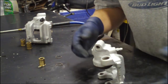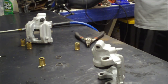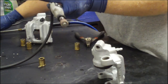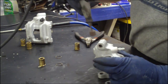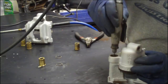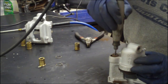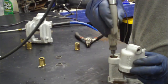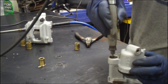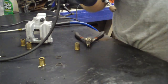You can use a wire brush or a couple of different things. I like to take my Dremel tool on a low speed with a light sandpaper head and just clean those out a little. You don't want to overdo this — these are what will keep your brakes perfectly centered and give you better pad life and wear. You don't want to take off much material; in fact, you don't want to take off any material if you can avoid it. You just want to knock down the rust until you get a nice shiny surface.